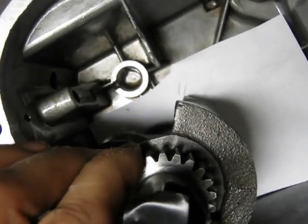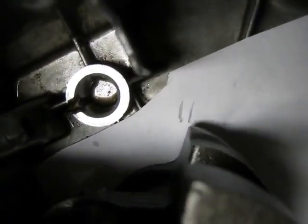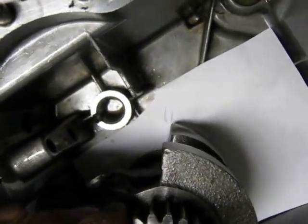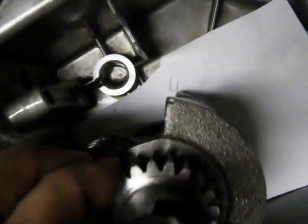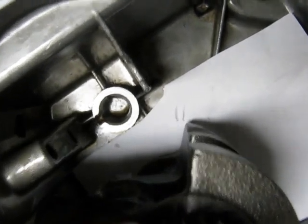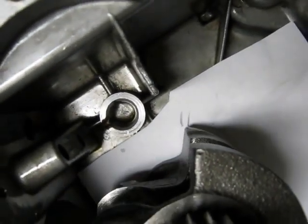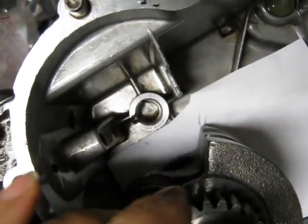The front cylinder has a piston in it, so it's not rocking there. When you have that much movement, and the joint between two and three has slightly less, when you add that up, it's going back and forth like this. So the gear there didn't like that, obviously. I'm going to try to tighten this joint up and show you the results. Hopefully I can get this engine running so you can actually hear what the exhaust noise sounds like, not the crankshaft slamming around like that.